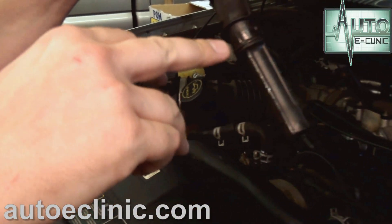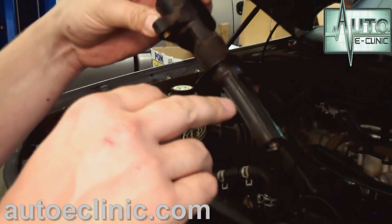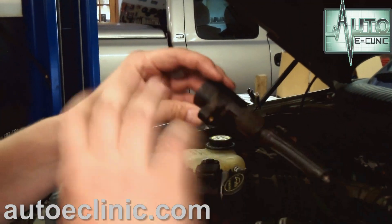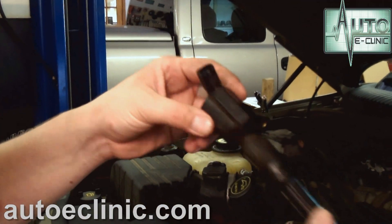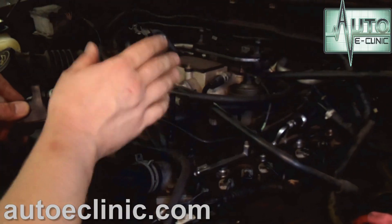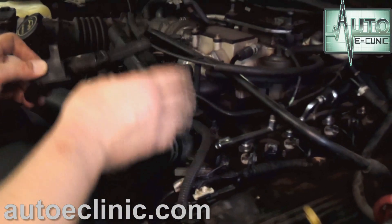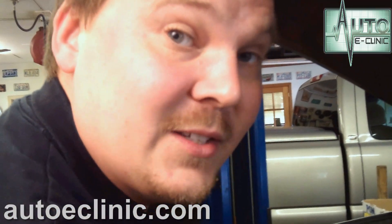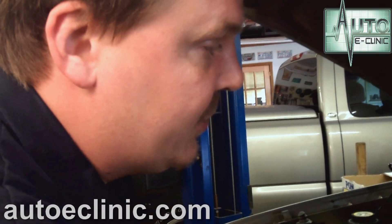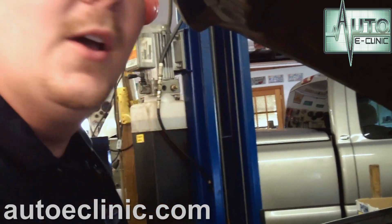Now, you can see from pulling it out, you can see where we've had moisture here. And moisture — if you have an intake leak — will soak into these boots and destroy them, and you'll have nothing but arcing and a misfire. So we know for a fact this coil pack needs to be replaced. Now, if we had a problem with it leaking as far as the intake, we would need to replace the intake gasket. This intake gasket has already been replaced, but the customer didn't replace as many coil packs as he needed to. So we know the coil pack is going to have to be replaced. We'll clear the codes, re-drive it, and make sure the misfire code goes away, then see if the P1285 comes back. If it's gone as well, we know we did our job.